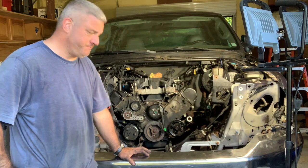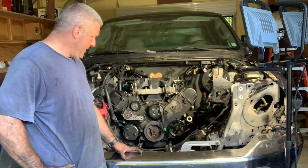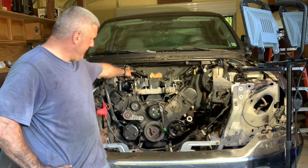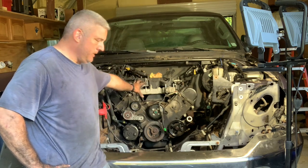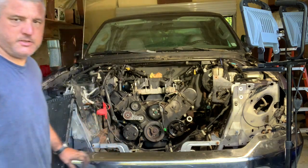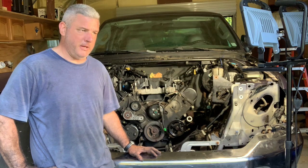Other than that, I got a lot done. Got the harness off up top and all sorts of little things. The throttle body just came off, the cold air intake, all sorts of hoses and things. Tomorrow I've got to get the plenum off, get the water crossover out, and get the intake out — that's going to open up the whole engine valley. And I've got to deal with the air conditioning. The condenser here I'm able to just lay over, so I'm hopefully going to do this without disturbing the air conditioning.